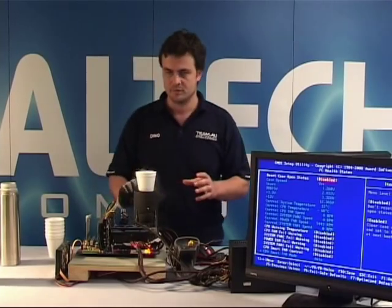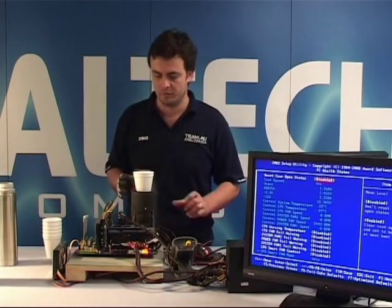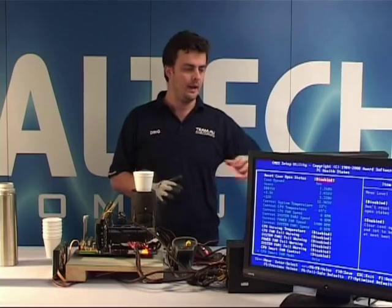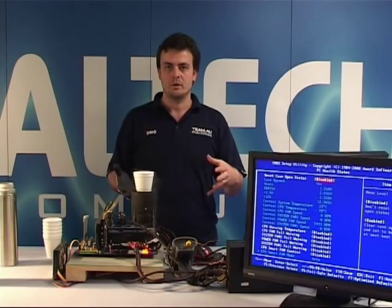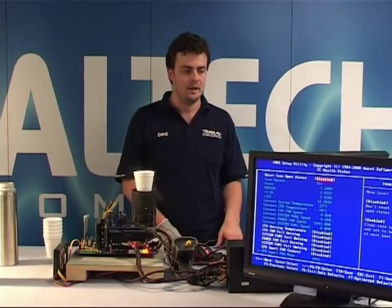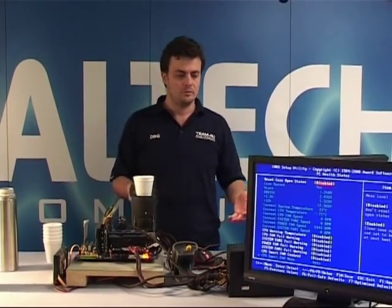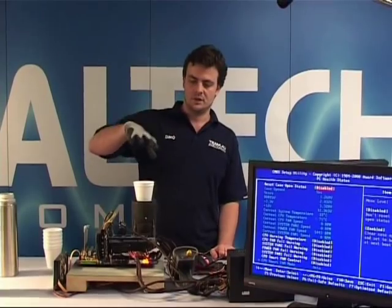It's also important not to overfill, not to fill more than say 20%, or where the copper ring is when you look down into the tube. If you fill the pot halfway up and you're about to reach your cold bug limit, you have to wait for the liquid nitrogen to evaporate and then heat up the CPU. If you've got a lot of it left, you'll be faced with a scenario where you have to sit with a heat gun for a long time before the temperature will go back up to whatever the CPU is able to boot up at. So it's best to go in small steps, always use small steps.